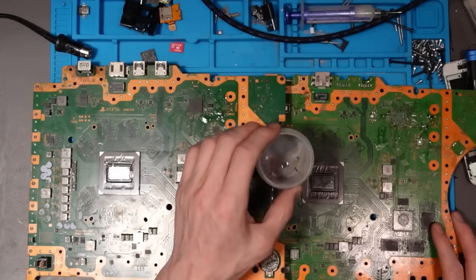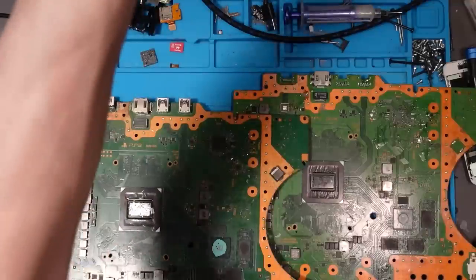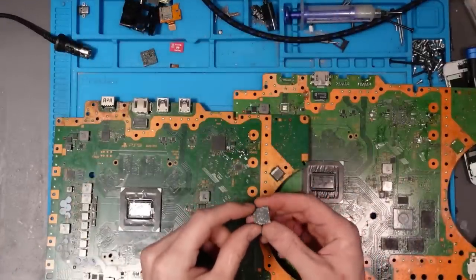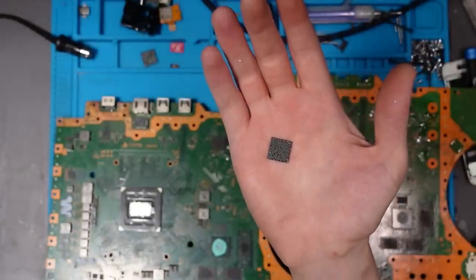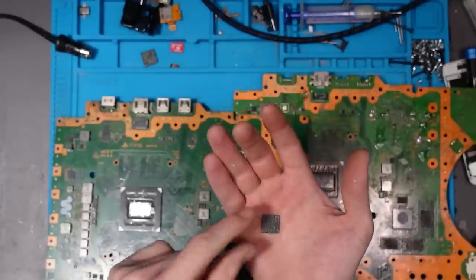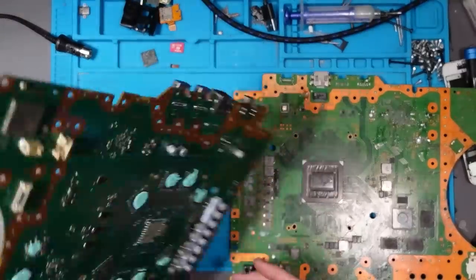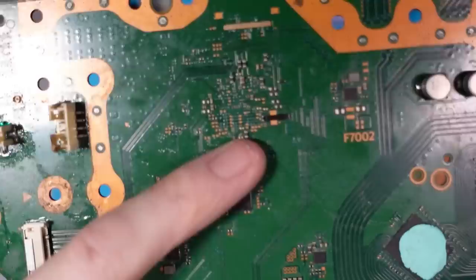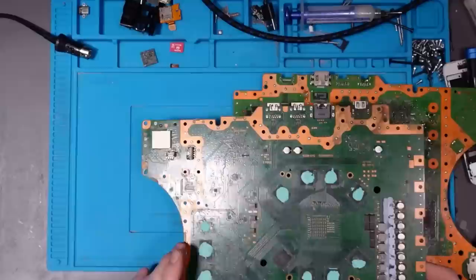The repair process involves re-balling the chip — taking the old encoder off, removing all the solder balls using a soldering iron and wick, cleaning off all the pads, and replacing every single one with a fresh solder ball, then soldering it onto your board. What that does is clear away any shorts, which are typically on the 1.1 volt line — you can find a short around the inductor at the bottom of that area. If that is shorted then you've generally got a bad Southbridge, and replacing it is going to be a significant repair.